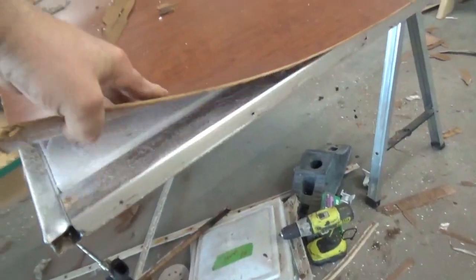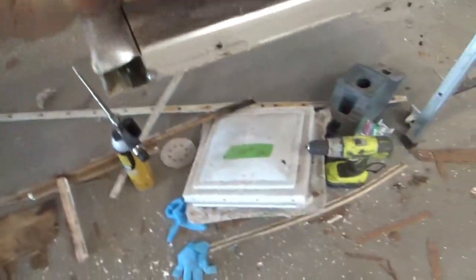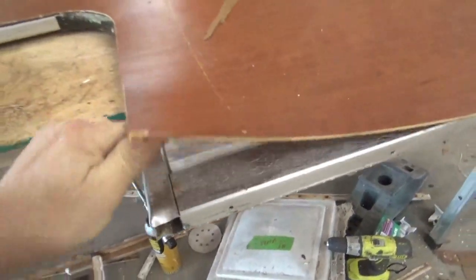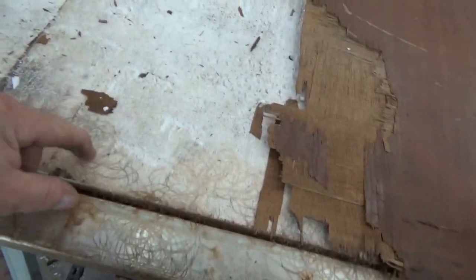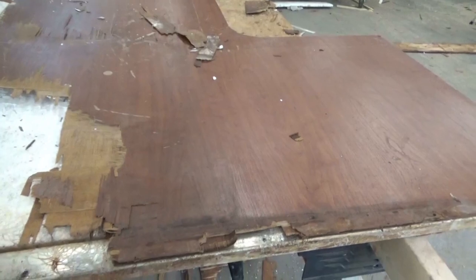What we found on this platform is that this really isn't glued that well. The other thing I didn't like is — you see that foam right in here — it's not glued either. I want all this, everything fully adhered to make it one system. So that's why we're tearing it up — we're going to rip it all up. They had glue on here a little bit and some on here as well, but this here isn't down as much as I'd like it to be. I want to get this glued to this as well, I want everything all glued together. So that's why we decided to take it up, and then put a whole new skin on it.